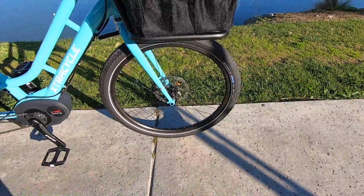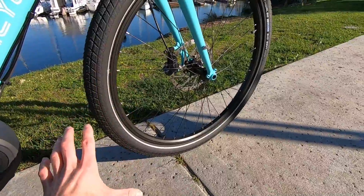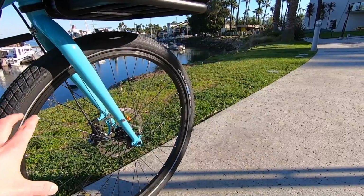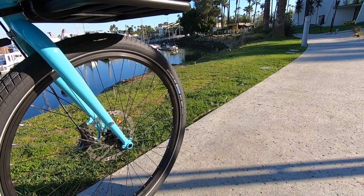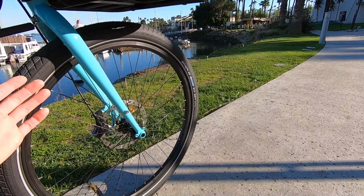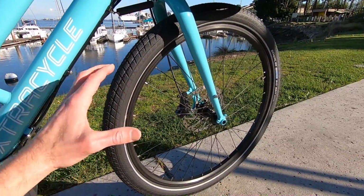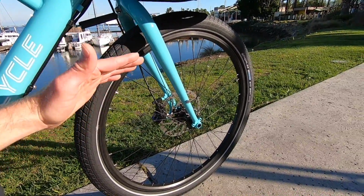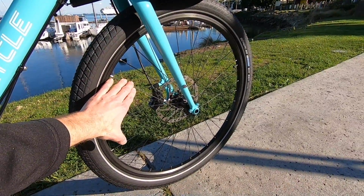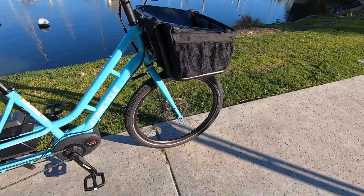It just makes it a little bit stiffer and stronger, and that's gonna support these slightly wider rims that give you a little bit more option in terms of what tires you're running. These are the Schwalbe Balloon Big Bens. They're higher volume, so it's 26 inch by 2.15. Okay, so it's fairly wide. It's got puncture protection, and that width's gonna give you some stability. Being a little bit smaller, this is not 28 or 27.5, it's 26. So the spokes are a little bit shorter, and they tend to be stronger, and it lowers the center of gravity on the bike a little bit. Okay, that's the front wheel.